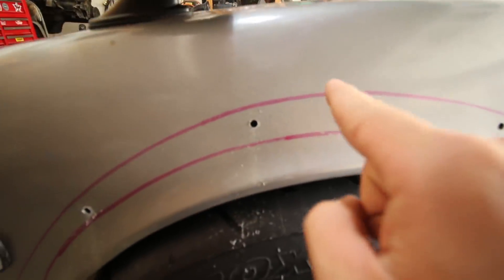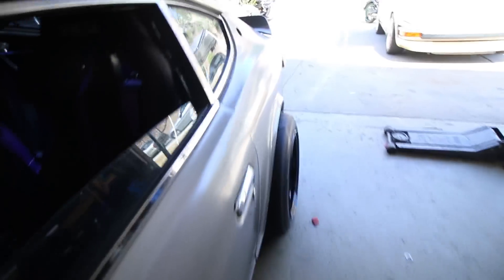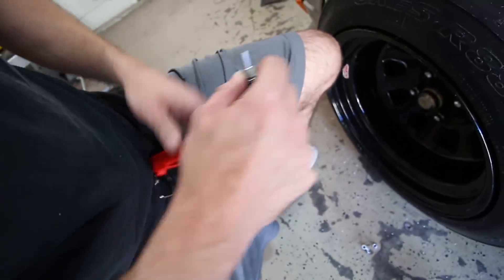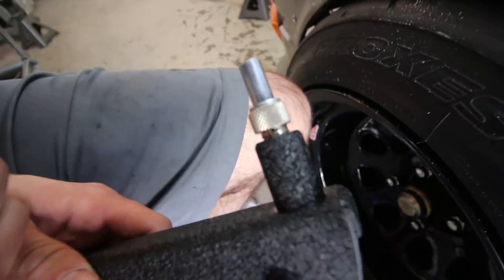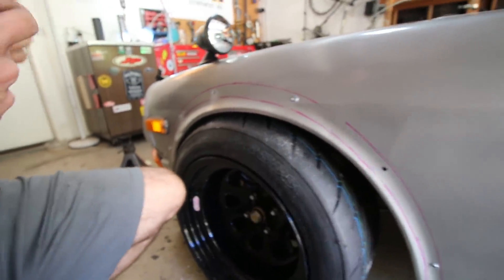There's no rhyme or reason to why this is exactly where it is - it's just that we liked the way it looked and it gave us the most clearance. So what we've done is taped it where it is. Now we're going to drill all the pilot holes in both surfaces so they line up correctly. You might know this thing is a nutsert or a threaded rivet nut, and this is just the installer for it. Basically it works just like a rivet would - you put it in the hole and squish it, and then it just squeezes up some of this metal and pinches it in between. This works great on thin metal that you want to bolt things to. Now we can thread our fenders into there. We're going to do the rest of these holes, then do the other side, take off the wheels, cut the excess off to give us clearance, bolt the fender on, make sure it fits, take the fenders off, paint them - and that's basically what we're going to do for this whole car.